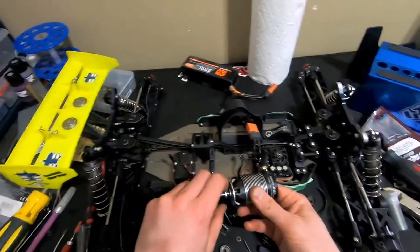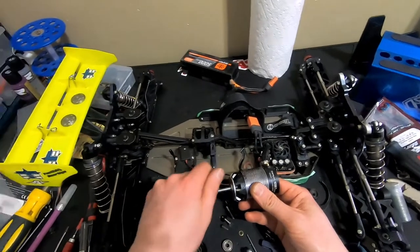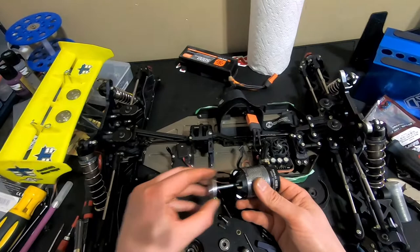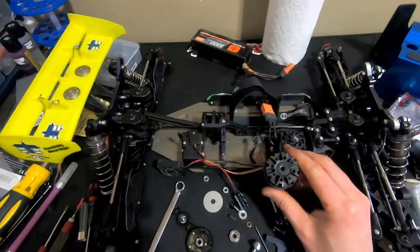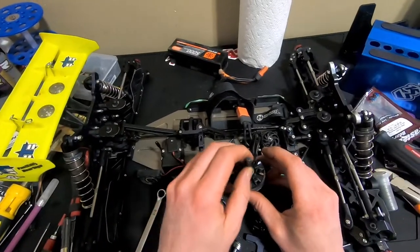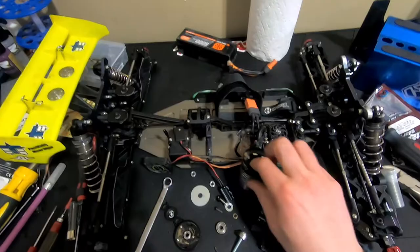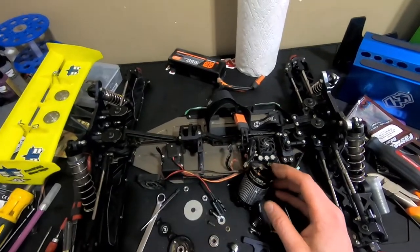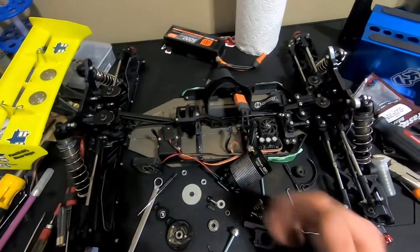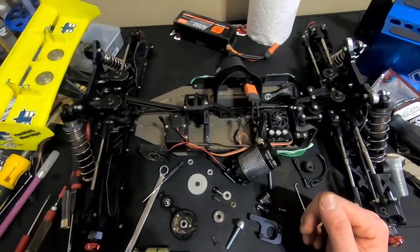Then just unscrew it all the way. I used a long bolt because it was easier to get into the motor. All you need is a couple washers — just make sure the bolt fits down the center of the bearing — and there you go, it's in. I already have a new one in there. Even for taking the bearing out I do the same way, put this in here, give it a couple whacks and the bearing falls right out. I wanted to make this little press because I didn't want to unsolder the motor. Instead of having it off to the side trying to whack the bearing, just a couple washers, a bolt, a nut — and that's it. I hope this helped anyone, thanks for watching.